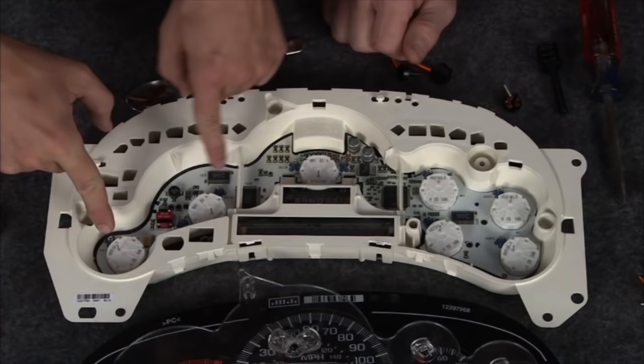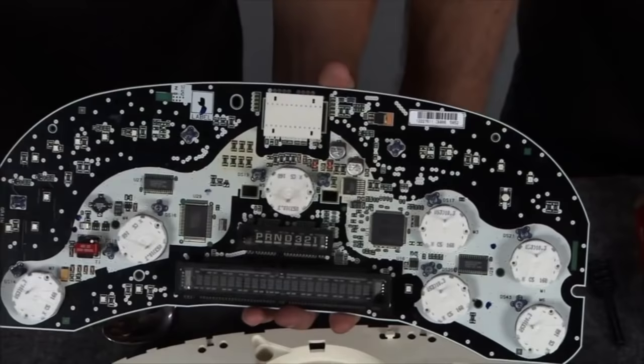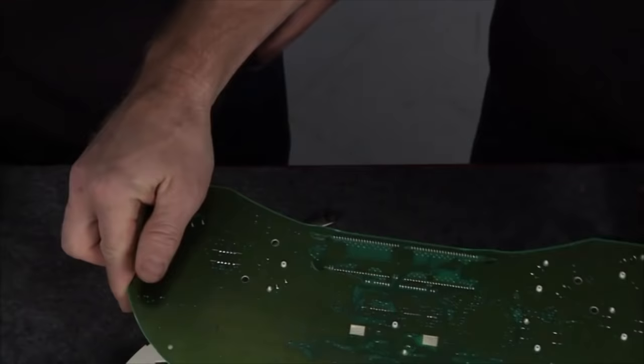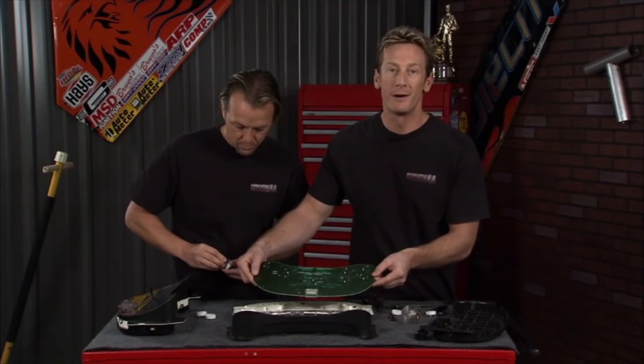Here's where the motors are. You've got the motors, the lights — all kinds of stuff going on. When you get it all out, you realize all of this is really just one circuit board. A lot of people want to try and replace these motors, but on the back side, they're soldered in. This is a pretty sophisticated circuit board, and unless you have a lot of experience with this kind of circuitry and can solder this precisely, you're probably better off not trying to tackle it. It's not a slight to say this might be above your skill level.